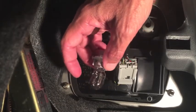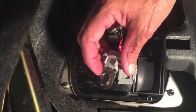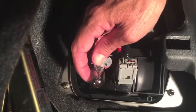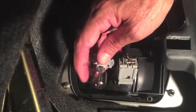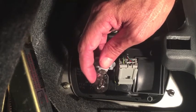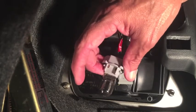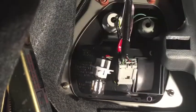I can see right away there's a piece of the brake light filament loose down in the bottom — you can see it there in the glass. The glass is also discolored; you can see how it's kind of a charcoal gray color. That color comes from when the filament burns out: it creates a little bit of smoke inside that stains the glass. So I know I have a burned-out bulb — it's gonna be an easy fix.